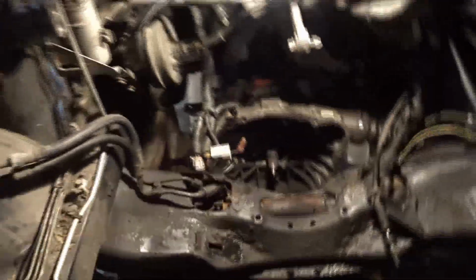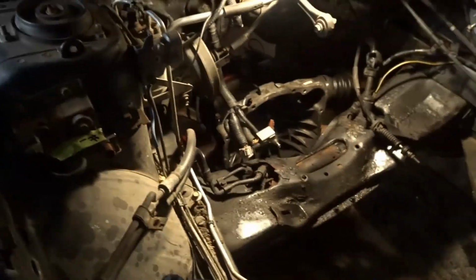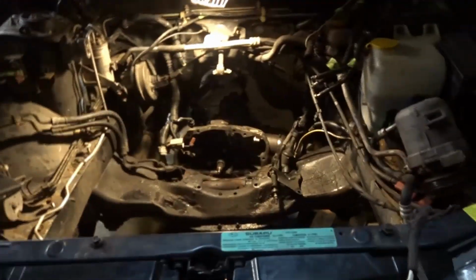After much troubles, it's out. Well, it's not out from underneath the car yet. I gotta jack up the front end to pull it out. The transmission jack doesn't allow it to go low enough. The biggest problem I ran into is the little keys, the ones they put into the output that the front axles slide over. These get sandwiched in there. The driver's side popped out fine, but for some reason the passenger side one was really messed up. And then I ended up getting my punch stuck in it real bad. I tried a couple tricks, but I couldn't get it out.